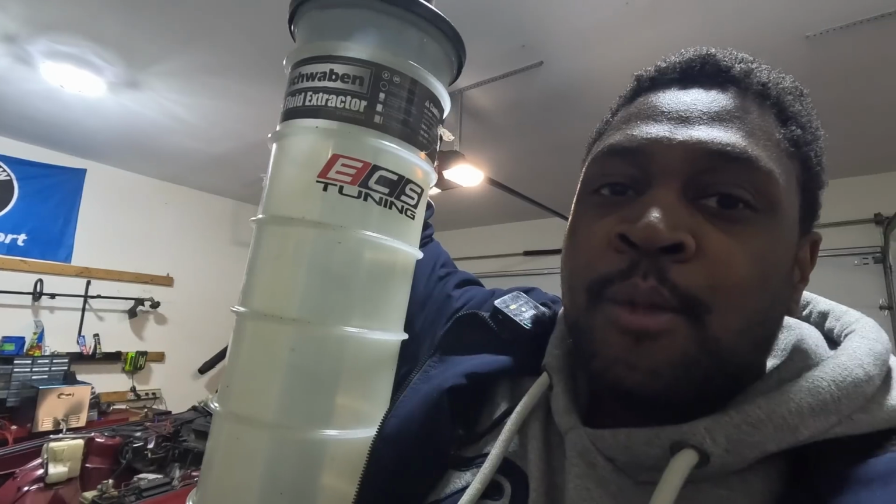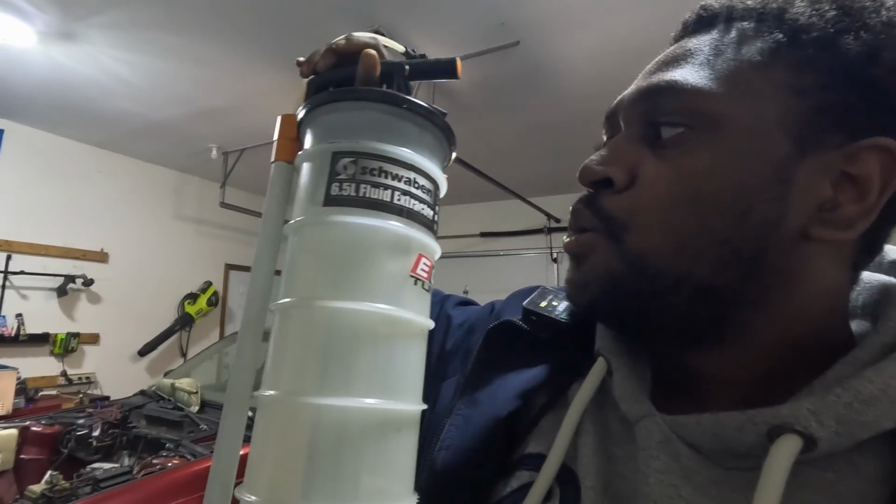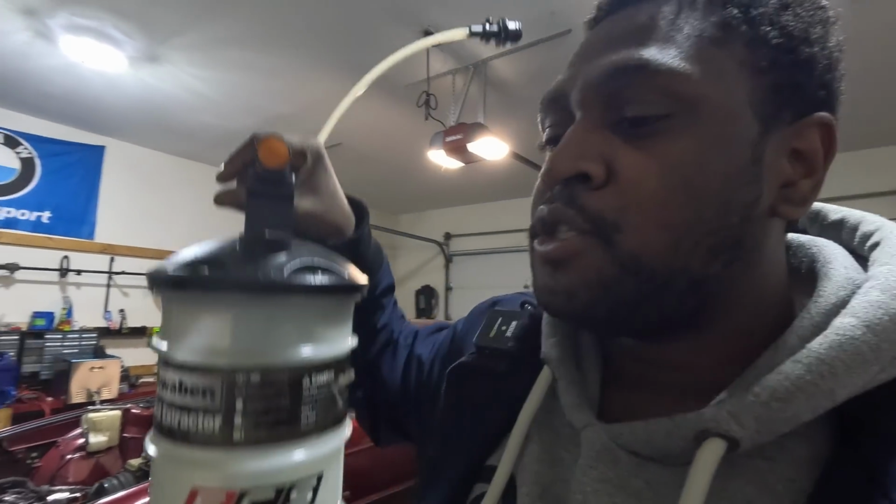Now you don't necessarily need air to be able to change your oil using the dipstick, because you can get a manual oil extractor or fluid extractor. This one's from Schwaben, and it came from ECS Tuning. It's all right. I like my one from Amazon better, so I can throw that in the links in the description, because that one not only had vacuum, but it also had push. So theoretically what you could do is fill this up with oil and then pump the oil back into the engine. It's a cool novelty. I've used it for filling transmissions and stuff like that. It's kind of helpful for that.